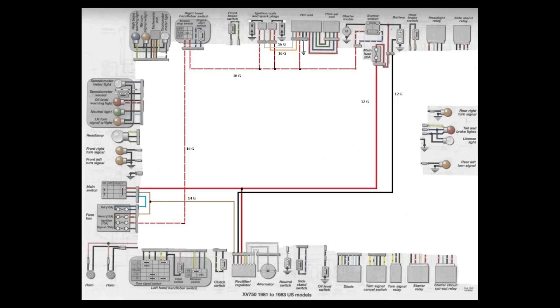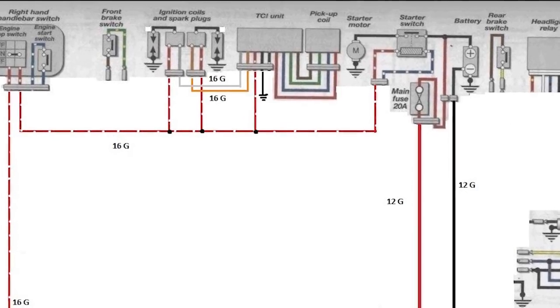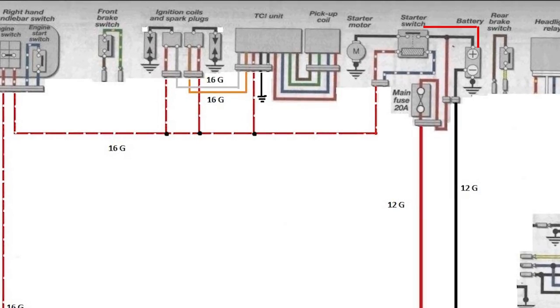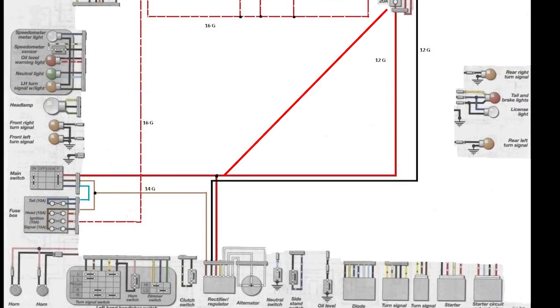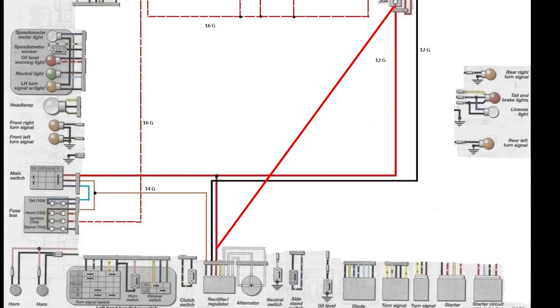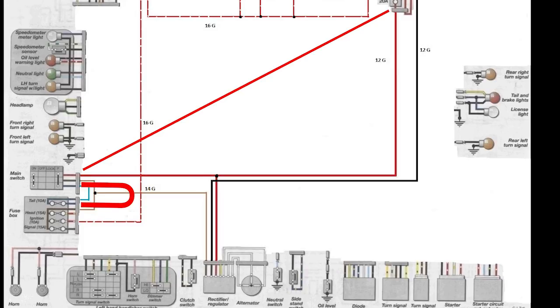Last time I had to stop my wiring was due to the fact that I needed a positive distribution block for these splits. I need to run a cable straight from the battery to a connection point because our wire needs to go straight into the starter solenoid. Follow the red wire. The positive wire gets a 20A fuse and from there goes to the R&R, and straight from the fuse into the ignition switch and back from that switch to the fuse box. In other words, the fuse box only gets current when the ignition is on.